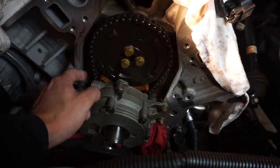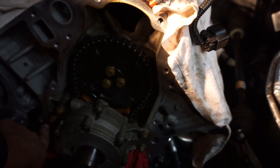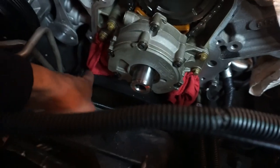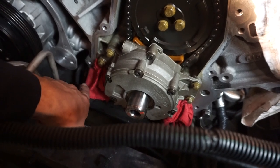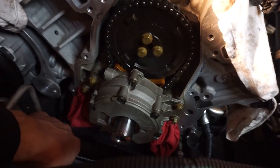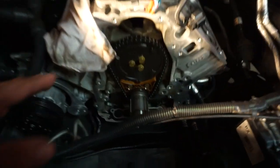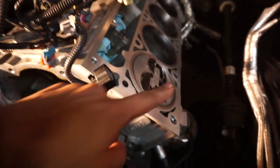Look at that chain slop — a good idea to change your chain while you're in here, and the tensioner for it, because that's a pretty substantial amount of play on this chain. Might as well change and upgrade it while you're doing that. Next we're going to go ahead and remove the oil pump. Some people say they can do the cam swap without doing this, however I'm changing the chain, so this requires the oil pump to come off. Be very careful because the gasket for the oil pump is part of the oil pan gasket — if you mess it up you have to change the whole oil pan gasket, which requires a lot more work. Now that we have the oil pump off, we can see that we are truly in TDC — those two pink dots line up right here and cylinder number one is on top.